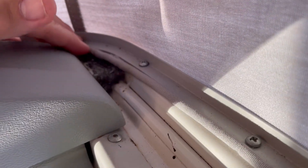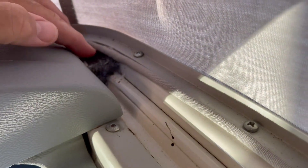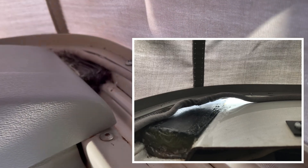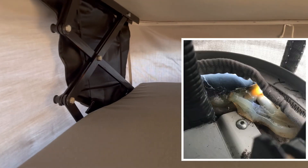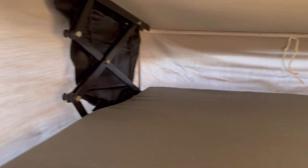Let me tell you about my experience installing this. Removing the original one is not that bad of a job except Winnebago silicones everything - the entire outside perimeter of this canvas is siliconed to the body. There are also silicone wedges in each of the four corners, especially in the back, and they used a serious amount of silicone back there. That's in the drip channels to keep rain from getting in.